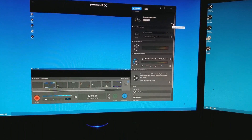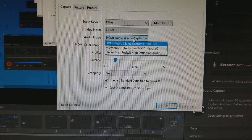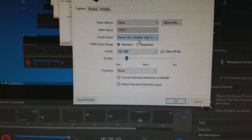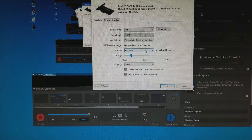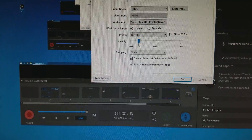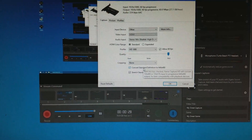Let's go through the settings I needed. What I needed was 1080p, 60 frames a second, and good quality. Video input is locked to HDMI. For audio input, I currently put stereo mix at the time of this video, but I've since installed an Asus sound card as well, which gave me more audio input options. I put the quality all the way up and left 'allow 60 frames a second' checked. And that was all the software setup — so you've had all the hardware setup and all the software setup.